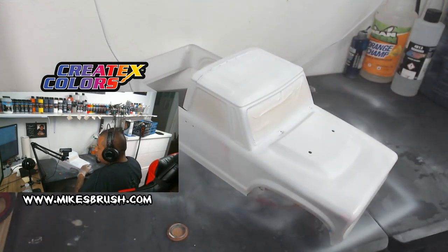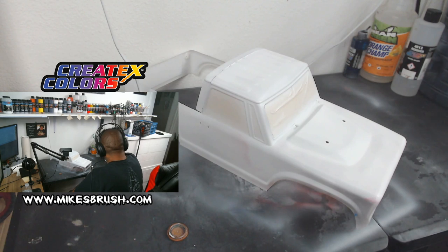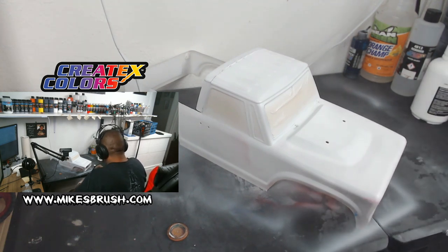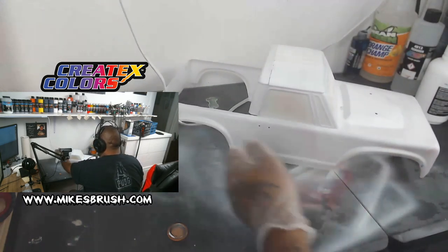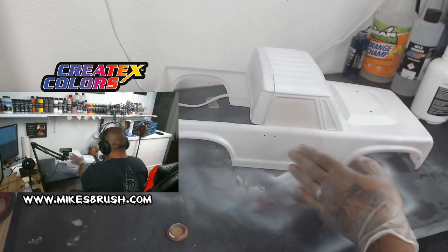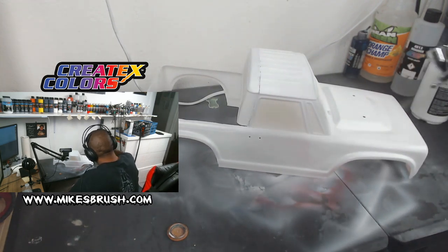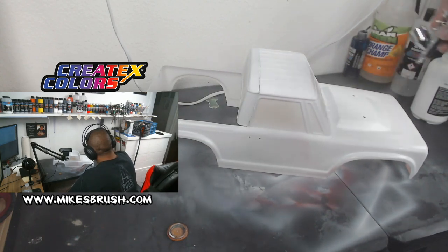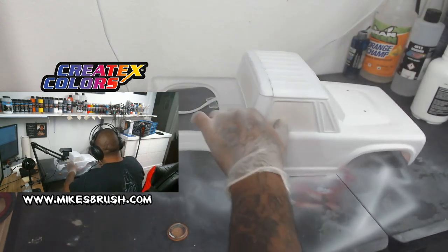Yo, what's up, Fishing the Backwoods? Do you thin the sealer at all? No. You can. It says you can reduce it 10%. So, honestly, it works really good straight out of the bottle. Dries up nice and quick. And reducing it increases the flash time, so I'm not trying to wait around. Have it be wet all day. Most of this stuff's dry already. Just make sure I get all the coverage.